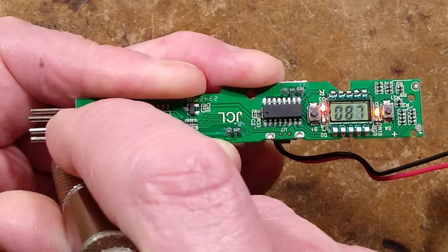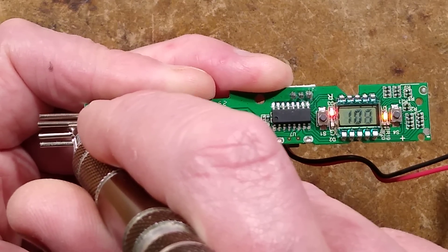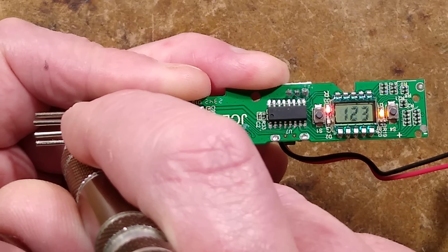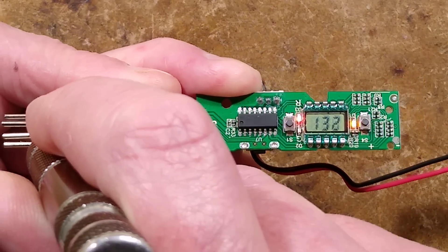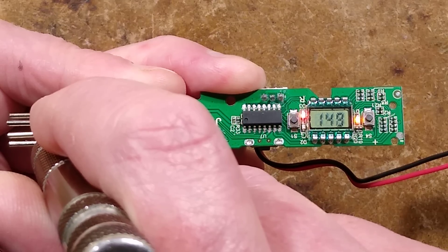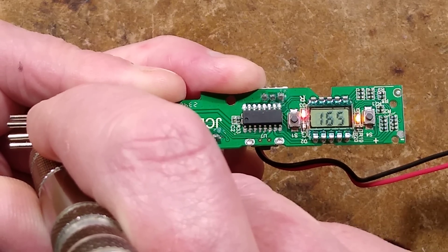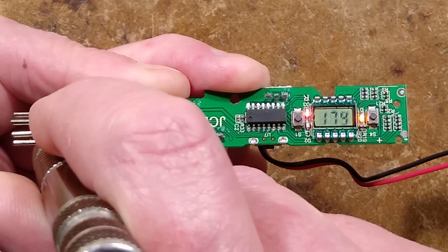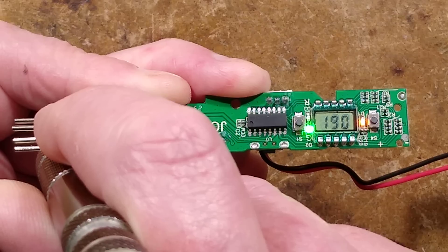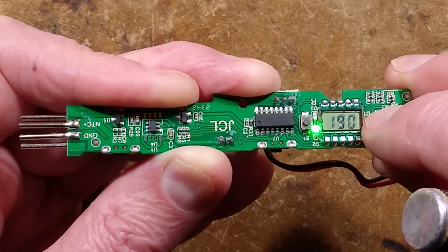If left on long enough the display will reach 190 degrees Celsius - which it's not really measuring. This means if the temperature sensor fails, it will just leave the heater on and you'll end up with very, very sticky overheated filament. The display changes from the red LED to green indicating it's ready - but it is not reading the temperature in real time at all.